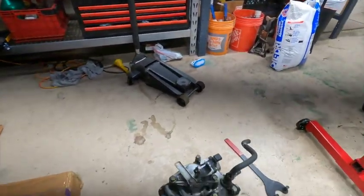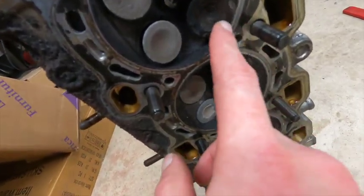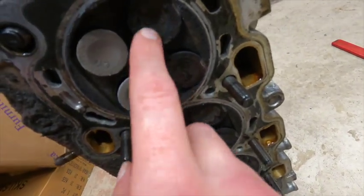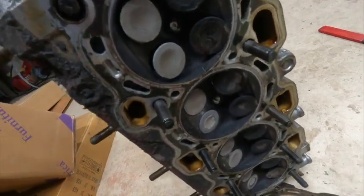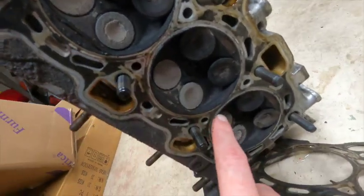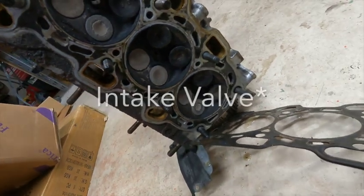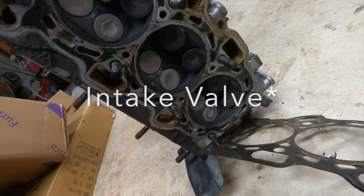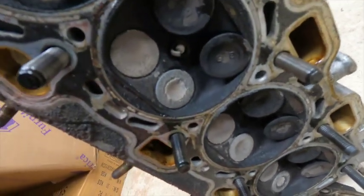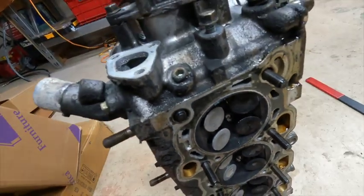Let's flick that gasket right off of there, and there you have it. So these valves are actually dug into the head. Sorry, let me actually focus. So those are actually in the head. These are actually in the head, bent. These are actually stuck in the head, every single exhaust valve. So every single exhaust valve is punched into the side there. I guess I could have scoped this and figured this out, but